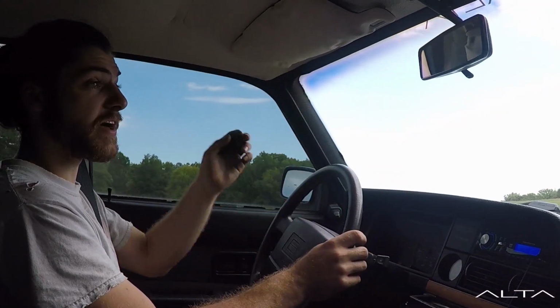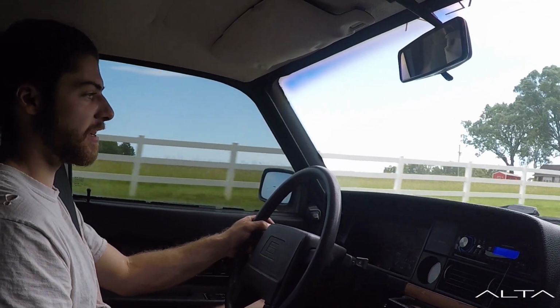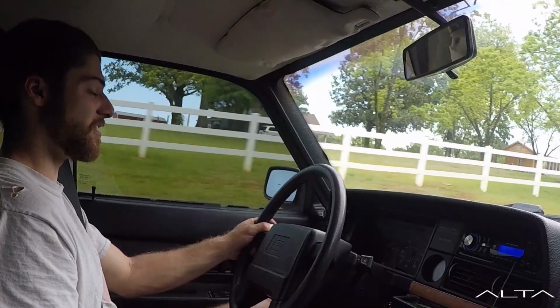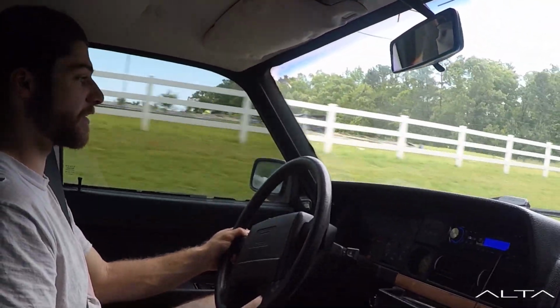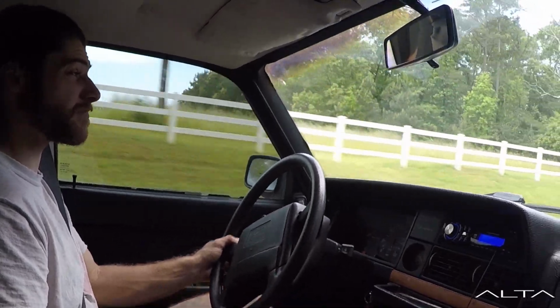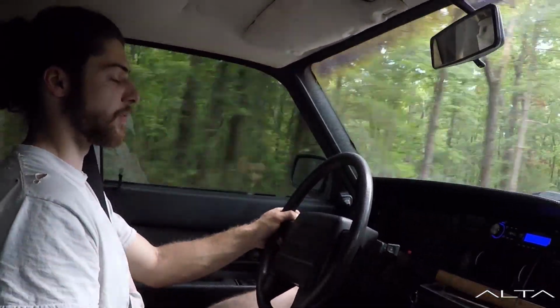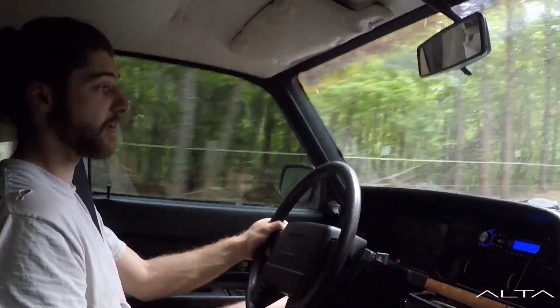I'm realizing that the rear is now damped decently, maybe a little bit underdamped, but it's really showing the deficiencies of the front. So the damping rate for the front doesn't really match the springs and the weight that's up there. I'm hoping that could be some bushing bind, maybe, because I didn't really break in the bushing. I was able to do that in the front. So when I do bushings, hopefully that'll help. But the rear feels much better than it did.